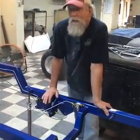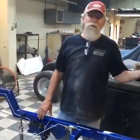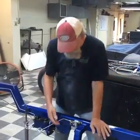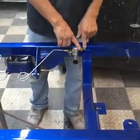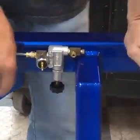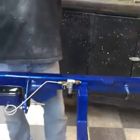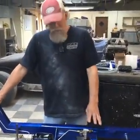On a T-bucket, the front end is so light, what you're wanting to do is you don't want your front end to lock up. You'll especially notice that if you're on a slick garage, your front wheels will just push. Or if you're on gravel, your front will lock up and your back will still be pushing. What this does, all it does is when you turn the valve, it cuts the pressure down going to the front. You can see right here it splits. It'll go this way for the right side, this way for the left side disc brakes. What we do on the T, you cut the pressure down a little bit. That way you don't get as much brakes in the front, and your back and your front are grabbing about the same time. On the bigger car, it's just the opposite.